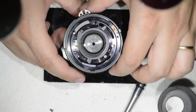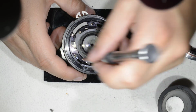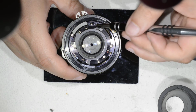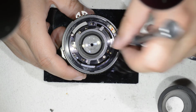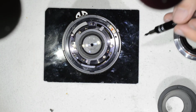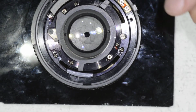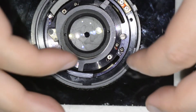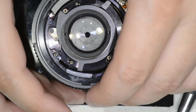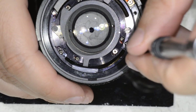But if you want to try and play with that, you saw these screws, you need to get them loose. They are into the small slot, and then here with a flat screwdriver you can rotate this element here, which is a pivot. So this guy here is a pivot, and then that is going to create some relative motion between the exterior and then the interior, where you have the optical assembly. But then we don't need to do here anything.